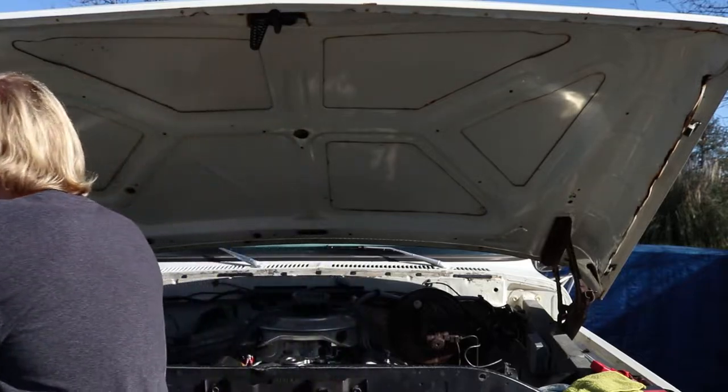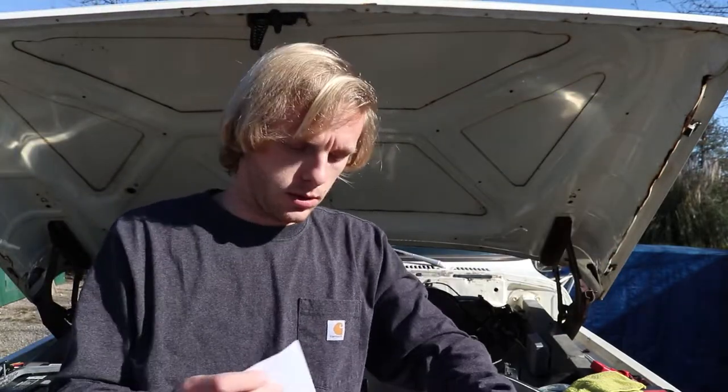We're going to start at the battery and work our way through. I have a whole bunch of stuff written down — we're going to talk about all kinds of stuff. I've got a wiring diagram, old parts, new parts. This is how it works. The first thing I will say if you own any older vehicle — DuraSpark is like 1970s to early-mid 80s — the one thing you want to check, the huge encompassing problem, is grounds. Make sure all your grounds are correct before you do anything else. Keep it simple stupid.